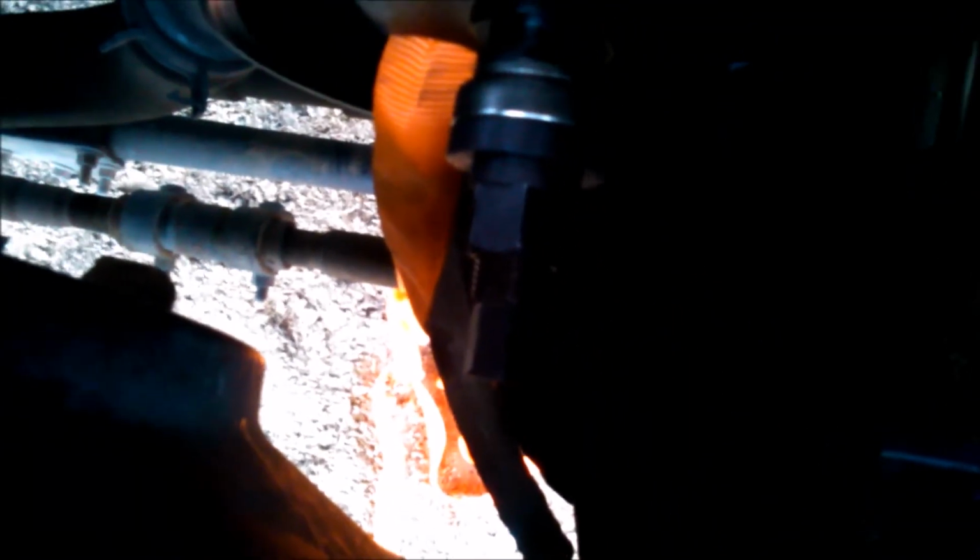A lot of the videos that I've seen show somebody ramming a long screwdriver or a steel rod or something through it, up against the flange or some of that. I don't really like that idea because A, it kind of puts it off at an angle, and also I don't know what I'm going to damage in the meantime. So I'm doing it with a ratchet strap tied off to some of the cross members on the steering down there, and that all seems to hold it nice and tight.